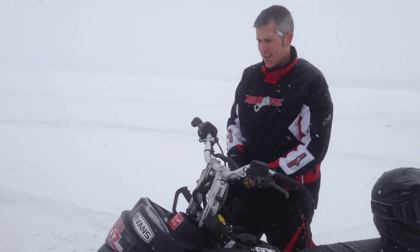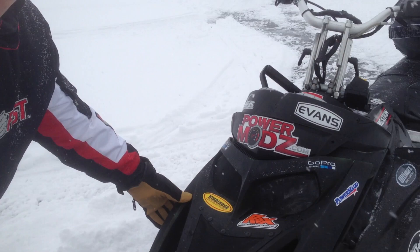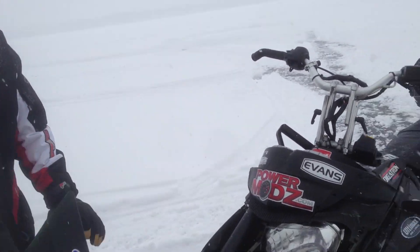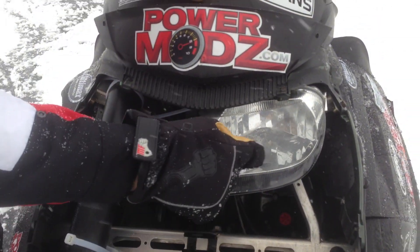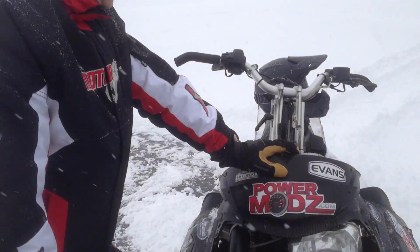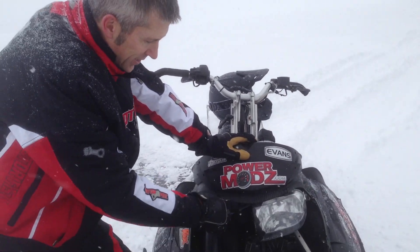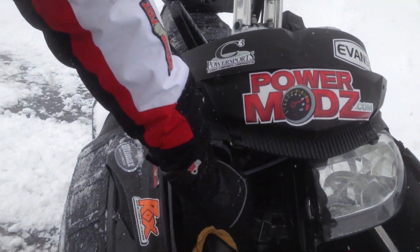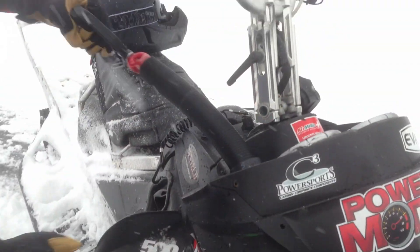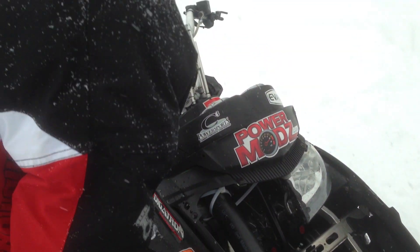What's with your one headlight there? I see you only got one headlight. Yeah, check this out boys and girls — I call that the one headlight mod. We've changed things up a little bit. I did the headlight delete, but then I figured if I'm not running that extra current to the sled, maybe if I turn the handlebar warmers on it might melt them — it happened on my ZX. So I took Keeley's spare headlight, cut it in half, gooped it up with some RTV, and I'm running the current through there. But I wanted to keep the snow bungee mod — that's my main impetus for not putting the whole headlight in.